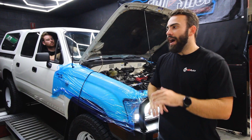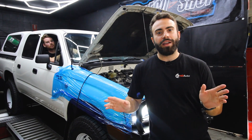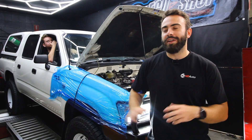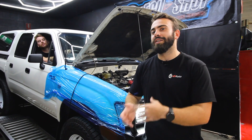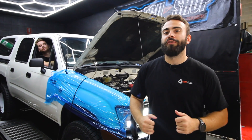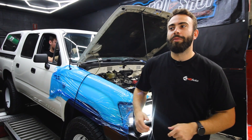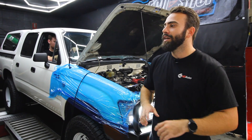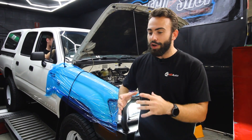A little bit of a backstory with these turbo kits — back in 2017 I bought myself a Hilux Surf for two grand. That is every dollar I had in the bank account at the time. Luckily my old man wrecked Saabs and had a few random European cars around, and I noticed there was a turbo on the Saab. I thought the CT20 that came on the Surf was a bit inefficient — the car didn't have much low-down punch. So I grabbed that turbo off the bench, got it on my Surf, and it was a Garrett GT1752. I had no idea what that even meant at the time, I just knew small turbos worked really well on diesels. It went so much better. I used random intercooler piping to do a front mount as well, and it gave me a lot of answers because I realized this works really, really well.